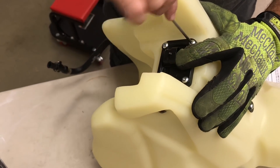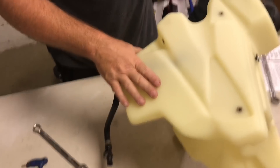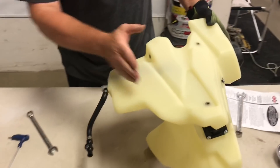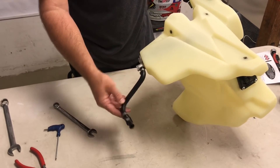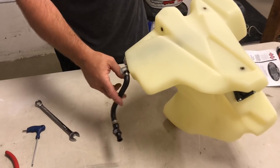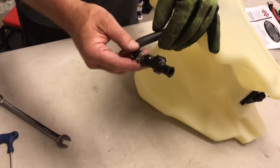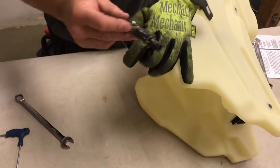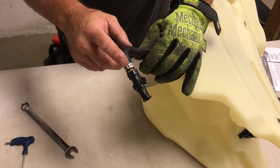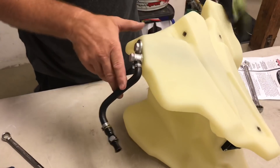That was a pretty good job by Cole tightening these. I'm going to double check his torque — it looks great, so now this is tight. I'm going to check fuel right now. When you go to put this on the bike, this tank will sit down a little bit lower, so sometimes the length of the fuel hose needs to be changed. I'll do a separate video on that — most likely you'll just have to shorten this hose or get a new hose. I have a tool you can buy on Amazon to do these clamps.